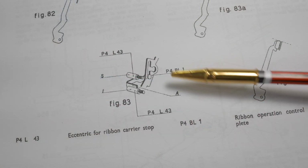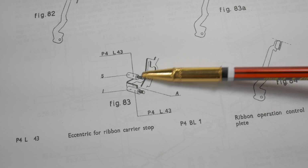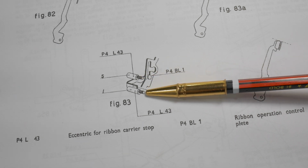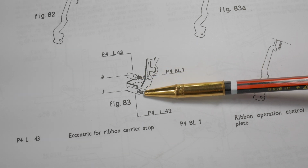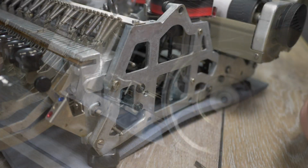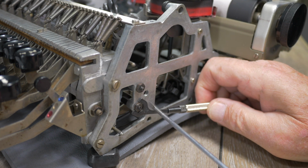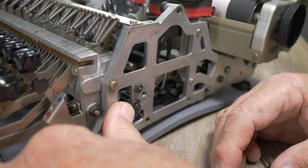Okay, so on the right side of the typewriter are two cam adjustments, these little screws with eccentric cams. The bottom one is for the top position of black color, and the top one is for the red color. So as I type a character, you can see that arm moving and hitting the cam. So that is the bottom screw adjustment, 7mm wrench. There it goes.